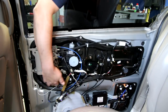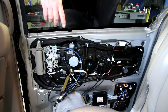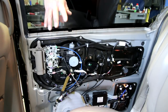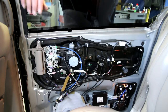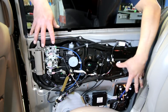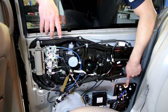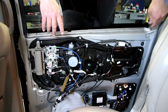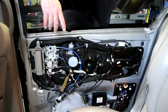In order to get to the back of that to take the screws off, I'm going to have to loosen this whole panel right here that holds everything together. It's a little difficult to get in here and record it, but it's pretty simple to take the panel off. Once you get this piece off, the rest are just clips that pull straight out. There is a screw down at the bottom — it has an eight millimeter head on it — way down there in the corner at the bottom. Also a trim piece up top here that you have to take off.